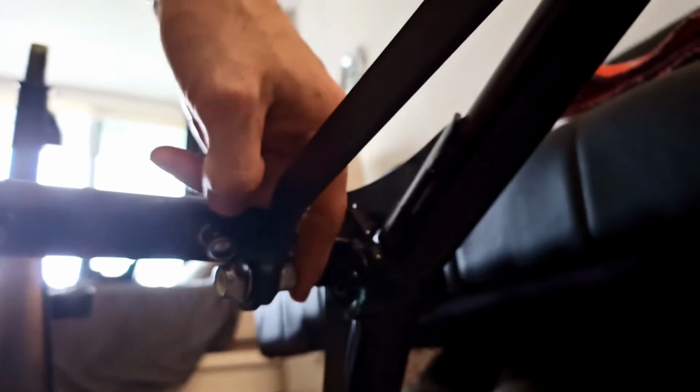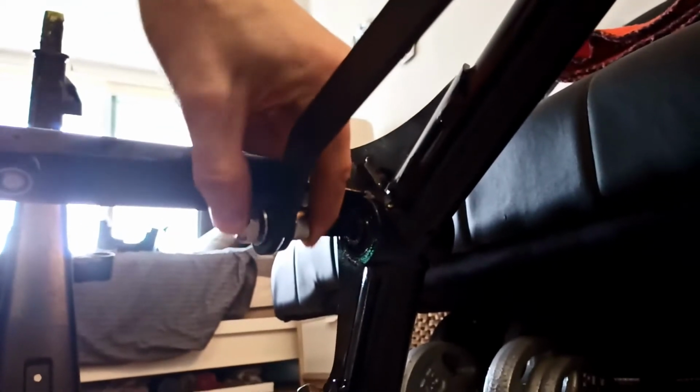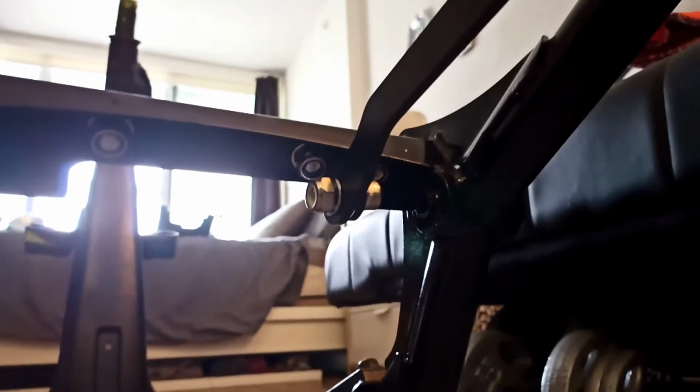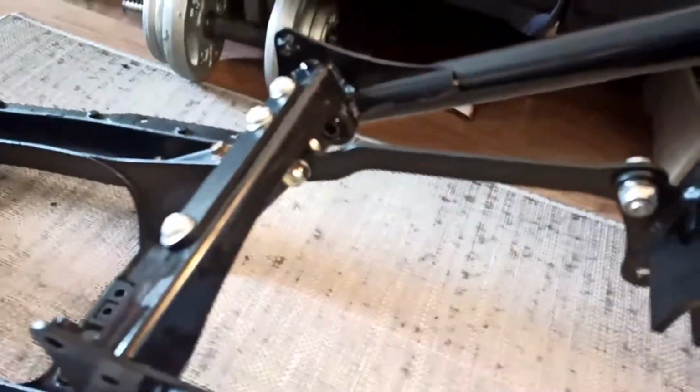So this bolt for my 8-inch bar length, you can see there's very little room here. I don't have the 90-degree Allen key that I can stick in this one side and then use the socket. And if I flip it, the socket is too big to fit. I'll just do a little test run and show you, because maybe I'm wrong. I don't know everything, as hard as that may be to believe. But you can see it's not going to work out. Even if I flip it, it's too much. So I have to get that 90-degree tool, but I'll visit that a little bit later.